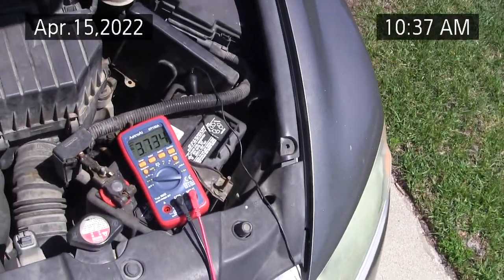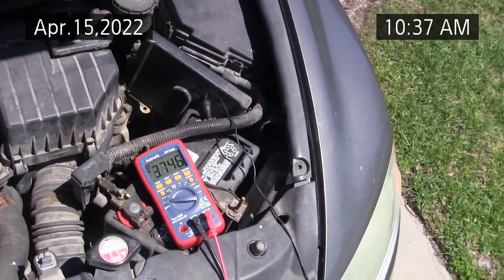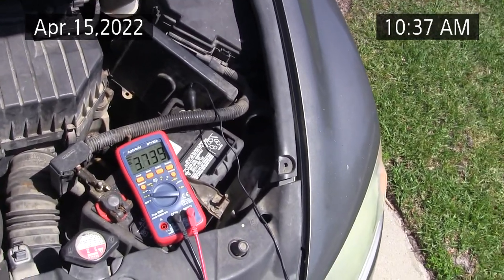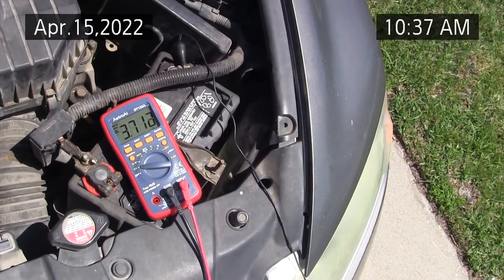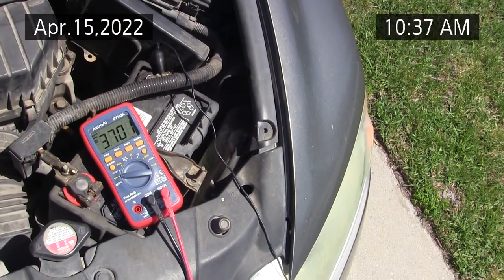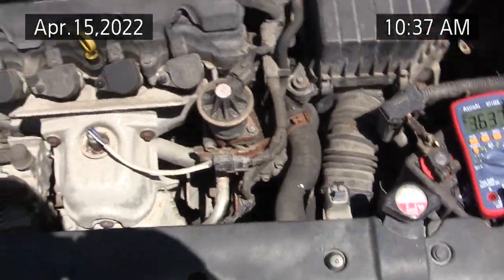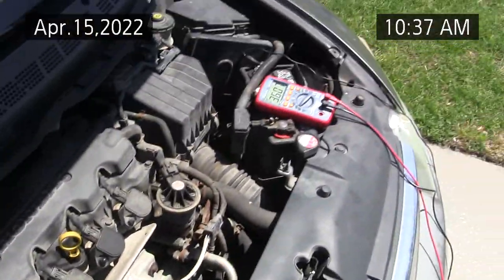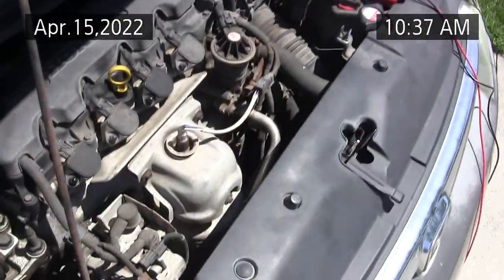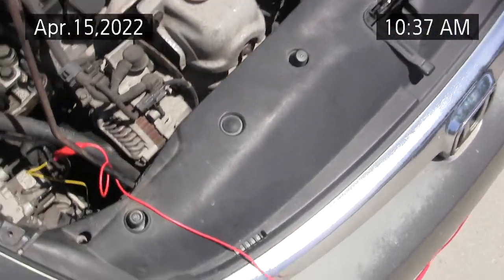But this voltage keeps coming up. High pressure ought to max out around 4.5 volts, I think. One good diagnostic to know if your system's overcharged or undercharged is the voltage. That's where I'm spending all this time on this three-wire system.